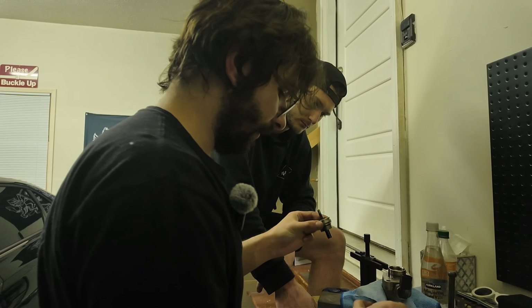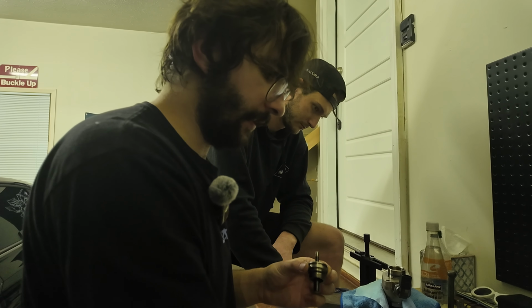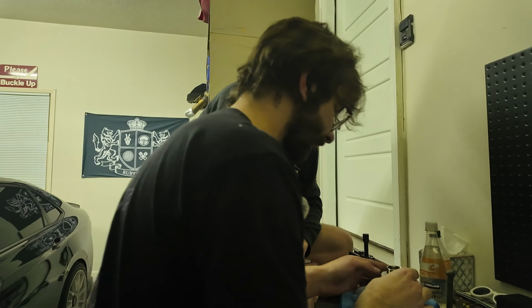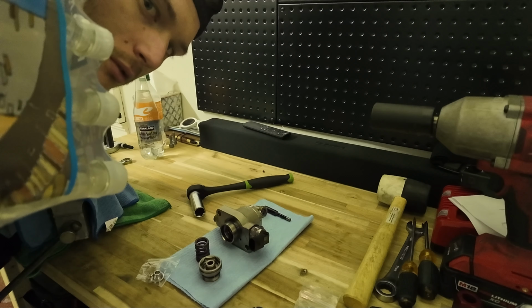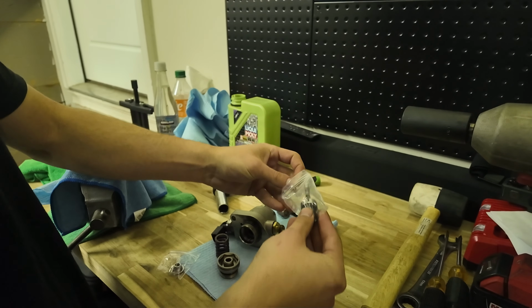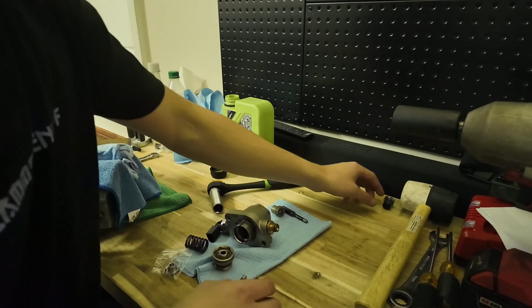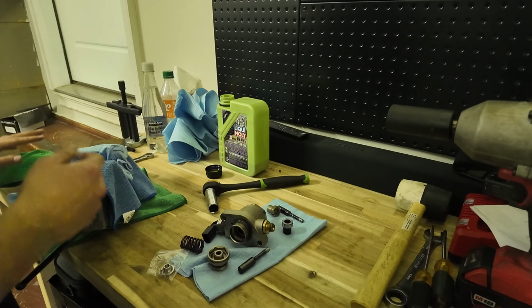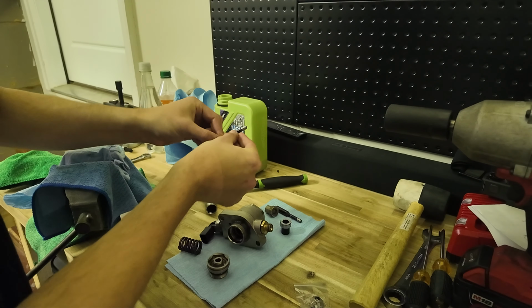Yeah, we gotta be very careful about debris, because the tolerance is very tight and this is a very small fuel nozzle. Let's clean this with some Harbor Freight brake cleaner. Okay, so now I got everything cleaned up over here, taking out the new internal, take a look. Make sure there's no dirt or anything on here, best you can at least. Obviously try to use lint-free stuff. I'm just gonna take a little dab of oil.